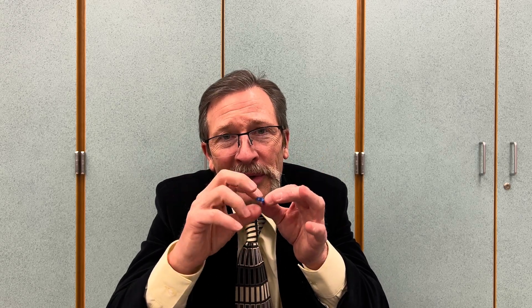Whenever you're working with fuses — whether inline fuses or the ones in your car — don't go cheap. I found out the hard way: I bought a no-name brand fuse and instead of blowing it melted the entire thing. Make sure fuses are UL rated and from a reputable company. Also, if you have a 15 amp fuse, do not replace it with a larger fuse — you end up making the wires in your vehicle the weak link.